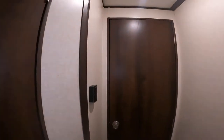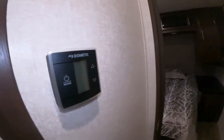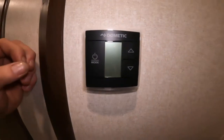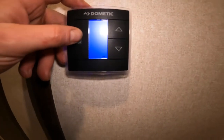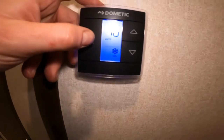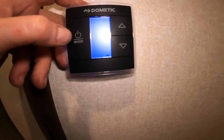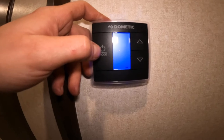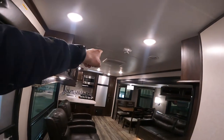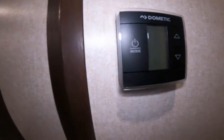We're going to go towards the front of your trailer to the main bedroom. Before we get there, we come across your thermostat. It has a capacitive touch button that allows you to cycle through fan auto, cool, or furnace. When running your furnace, you want to make sure the fan is on auto — if it's on high, you will get air blowing through the AC. It won't be cold air, but it'll still use the AC fan to try to achieve the high fan setting.